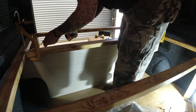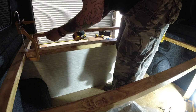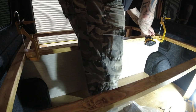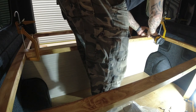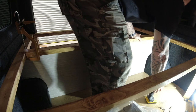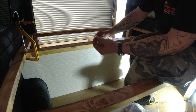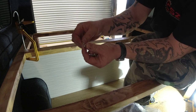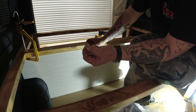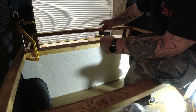So now that's in place. Along the top edge of this side of the board, I'm going to screw this furniture board to this beam using these long self-drilling screws with screw cups on, just to give it a nice finish. I know it is the garage area and it's quite high — you're not going to see much of it — but I want it finished properly, and these screw cups do give a nice finish to a screw head. So I'll move the camera around to that side so you can see exactly how I do this.